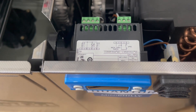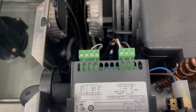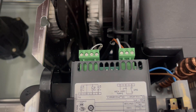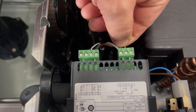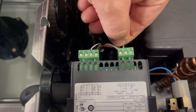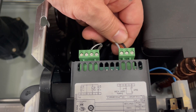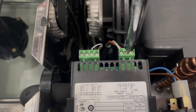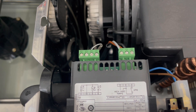To make sure the chiller itself was still good, they had me do a few troubleshooting steps, one of which was to check the compressor. They had me remove the black wire and put it in with the brown wire. At that point you plug in the chiller to see if the compressor starts. Now that we know the compressor is still good, we can get all the wires where they need to be and change out the controller for the new one.